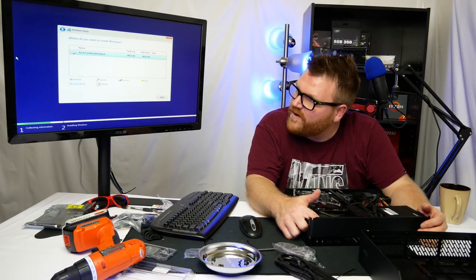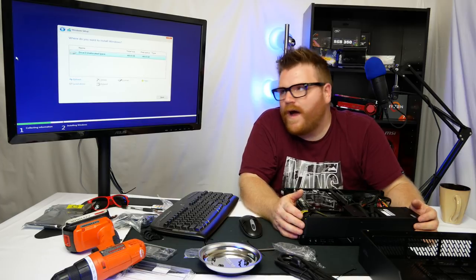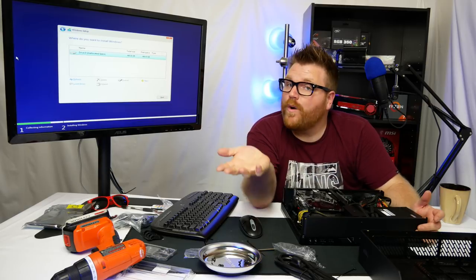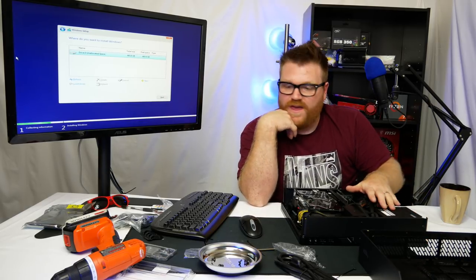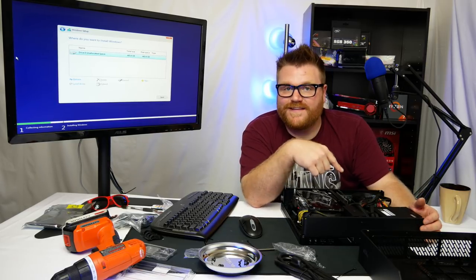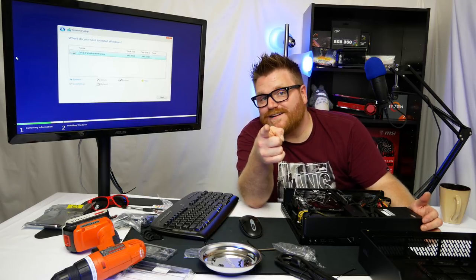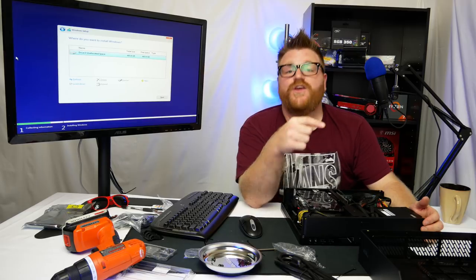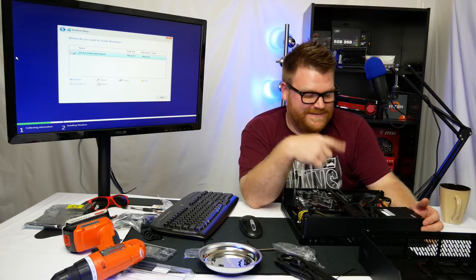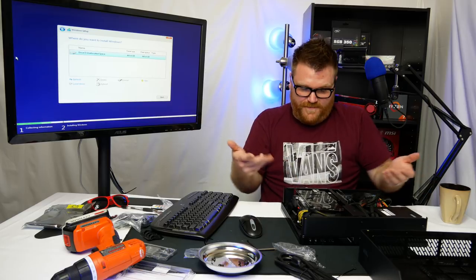So I got a floating hard drive in here, and I think I will give myself the pass on that one, because number one, I wasn't sure about the memory. Memory works, super cool. Number two, the cooler that comes with the 1500X, the Wraith Spire, does not fit in this case, oddly enough. So guess what, Charlie? No, your name, Russell. You're getting a Wraith Spire cooler with your Ryzen system that I'm sending you in the mail instead of this dinky Stealth, because the Stealth is going to be required for this build.